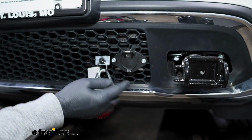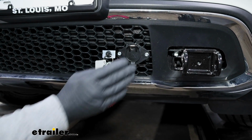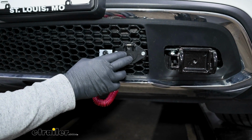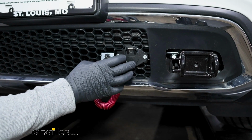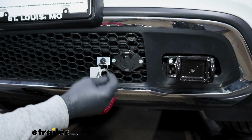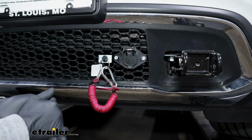your vehicle's 6-way round type connector. When you plug into here, the other end of the cable that plugs into here will go to the 7-way connector on your motorhome. It's going to receive that power from your motorhome 7-way from the 12-volt auxiliary circuit, and that's where it gets the amperage from.